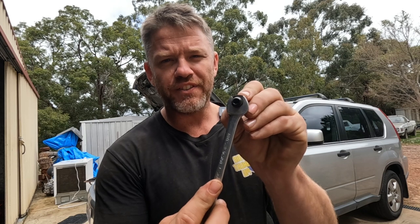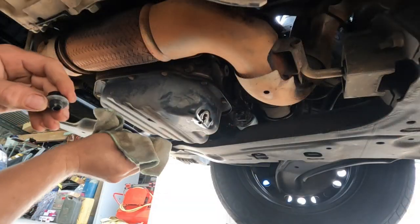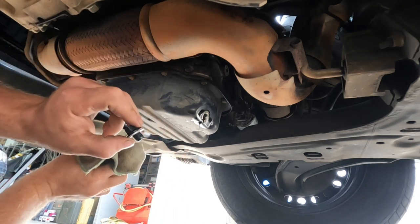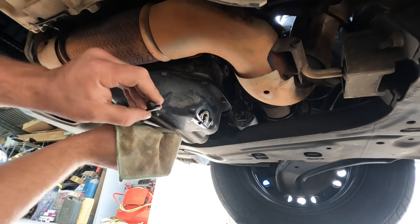Just a little tip: if your washer is damaged and you need your car to run down to the shop to grab a replacement, grab a spanner and work out what size it is. In this case a 12mm spanner fits the sump plug, so you need a 12mm washer — you can refit the old one for now and grab the new one later. Another good rule of thumb: either leave the sump plug out or refit it tight so you don't forget it.